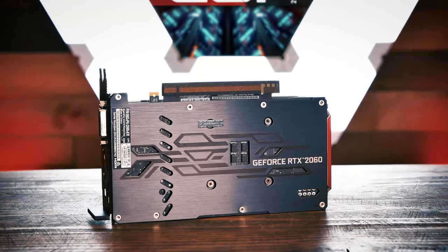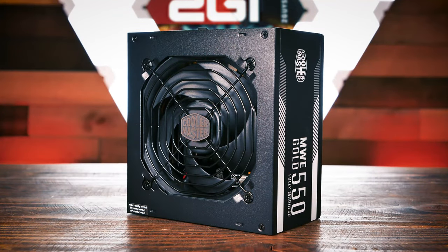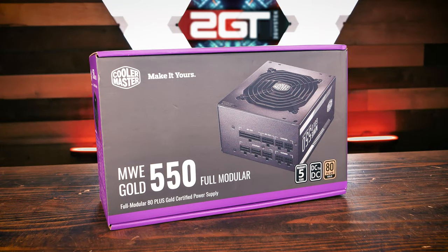We bought this card before the release of the RTX 3000 series GPUs and the following GPU shortage in the market. Powering all this gear will be a Cooler Master MWE 550W PSU. We chose this 80 Plus Gold Certified PSU because it's fully modular — so cable mess is minimal and we can keep the build tidy — and it was a good deal at $90. This is our first time using a Cooler Master PSU, but we felt comfortable choosing it because it has a five-year warranty.